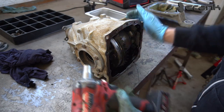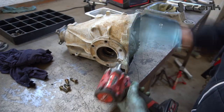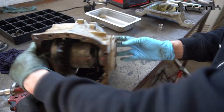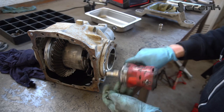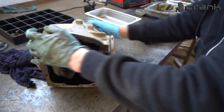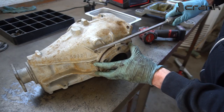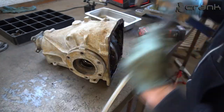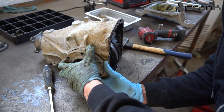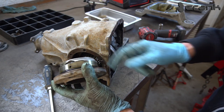Okay, now I'm going to continue with the removal of the bolted flanges. So let's undo the 6 bolts. Now let's see how easily our flanges are going to come out. Okay, this is the O-ring which I was talking about.